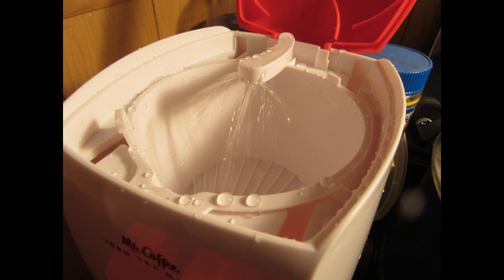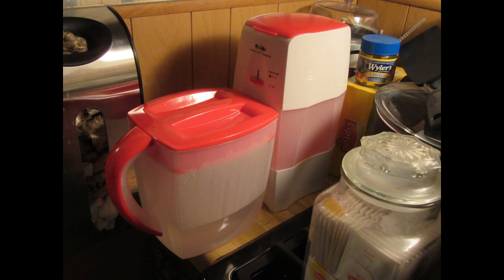The user just presses the on button and the rest of the sequence is automatic. The shower head does not spray water constantly — rather it spurts as the percolating action of hot water coming up from the heating area reaches the shower head. When the initial cleaning sequence is complete, there is no more water in the reservoir to feed into the heating area, so the heating element temperature rises and a thermostat automatically turns the maker off. There is no alarm to let the user know that brewing is complete, but the on button will no longer be illuminated. There is no harm in not noticing when brewing is complete, and the maker can be left as is. All the water ends up in the pitcher, and since this was a cleaning sequence, the pitcher just gets emptied into the nearest sink.